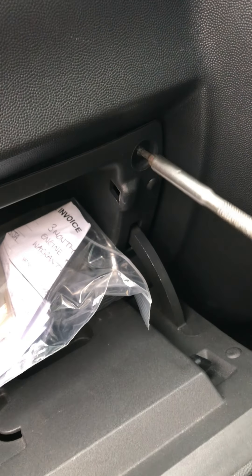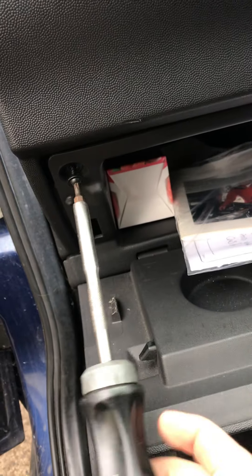First things first, we have a Torx 20 — they're here and here and underneath another one here. The Torx 20 bolts removed — there's only four, two in the top left and right corners and then two at the bottom. Once they are out, the glove box simply just moves like that, nice and easy. And right there, look under here — here is your heater fan.